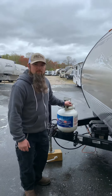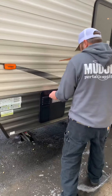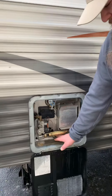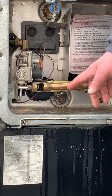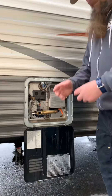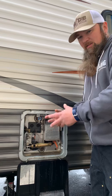If you have your battery in there, you do have to check the water level in it once a year. That battery runs the RV when you're not plugged in or plugged into your vehicle — it also powers the breakaway switch. If the trailer somehow comes completely off your vehicle, the cable gets pulled out and locks the trailer's brakes. The battery is only for lights and the blower on your heater; shore power would still be needed for air conditioning or microwave.